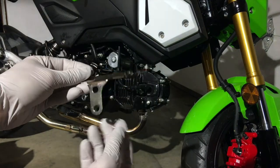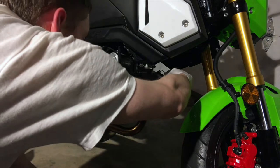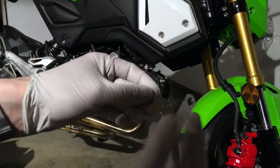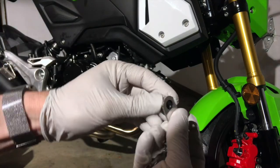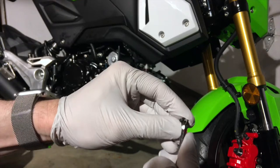To start with we're going to load the grommets into this bracket. The way this goes is it's going to attach to the tap cover like this and then hold the radiator off the front. We're going to shove each grommet by pinching the grommet and kind of forcing it through the hole with your finger.